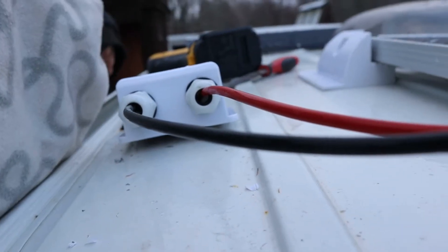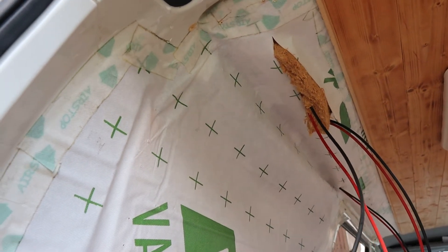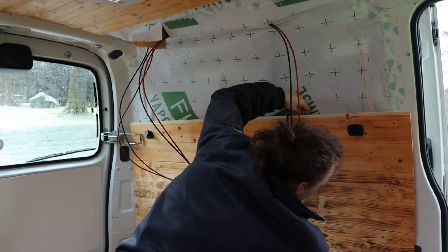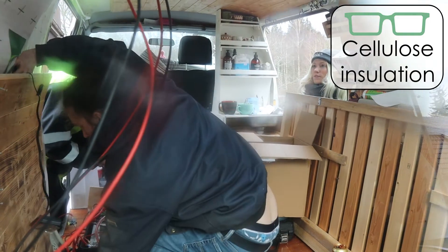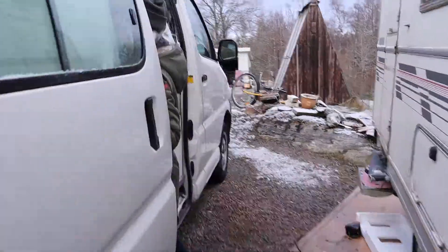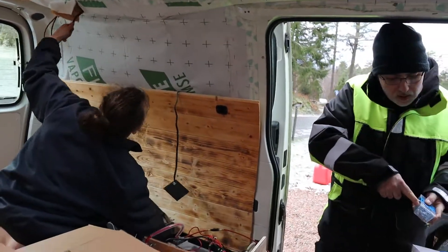Something that was actually great about taking down the ceiling and opening up the wall was that we had a chance to check the insulation and see that it was still fine — no moisture, nothing. It was still really good. In the van there is a wood fiber insulation and some kind of paper insulation, and I was afraid it was gonna absorb moisture, but it breathes so if it gets wet it also dries out when it's warm or dry. I'm really happy to see that it survived for the last two years and hopefully for much longer.